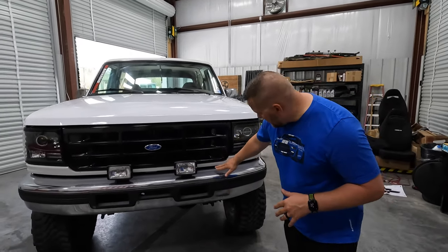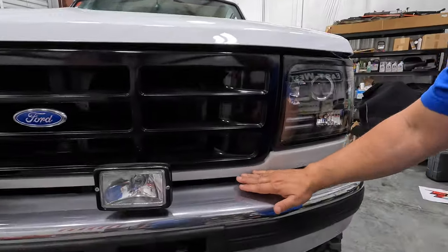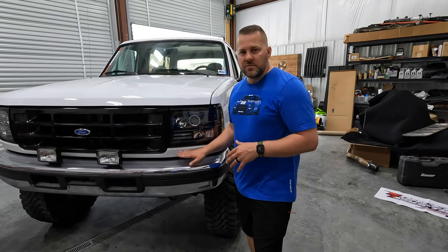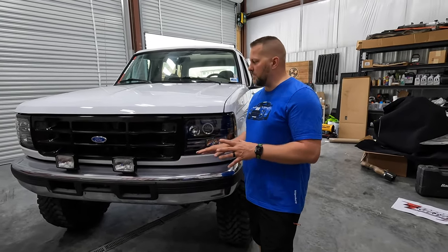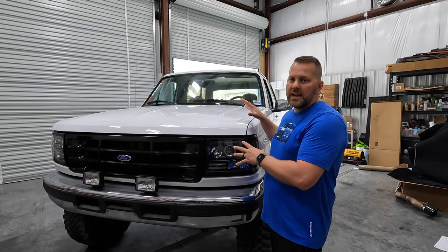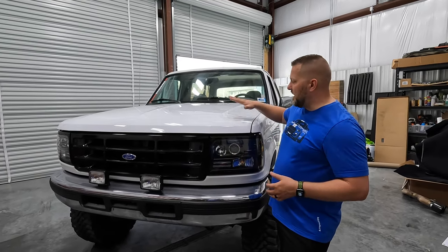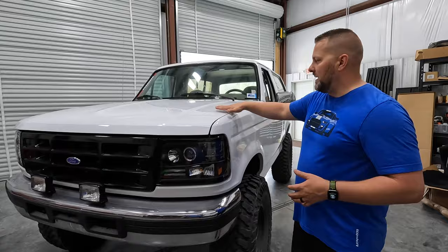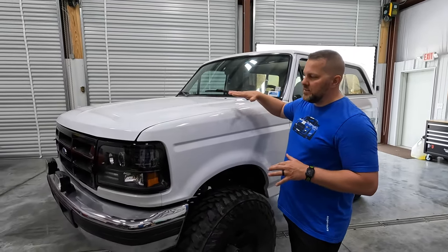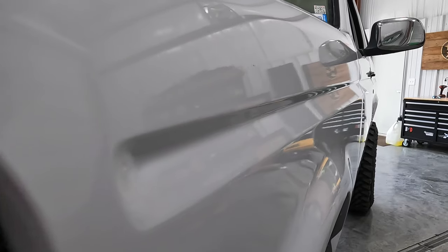They did not paint the piece below the lower grill and headlight assembly — that has to be taken off. We may pop that off when we replace the bumper and take it over to get it matched. They actually tinted the paint to match closer to what we already have on the vehicle. There's not much that didn't get painted — the whole hood got painted. Keep in mind it still needs wet sanding to take out the remaining imperfections.